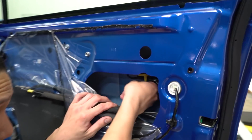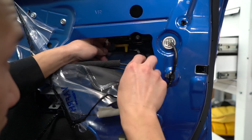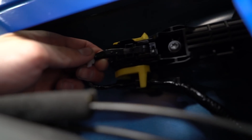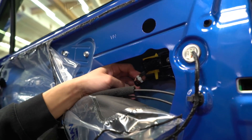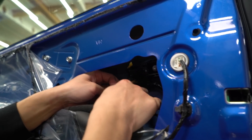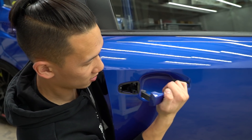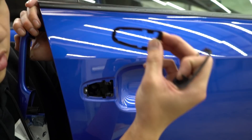On the inside there's a yellow tab and a harness. Grab your pick tool and go for the harness first — this is for keyless entry so the door unlocks when the key is nearby. Disconnect that harness plug. Next, pull this yellow lever down and out — this is what locks in the door handle. Now go to the other side and pull out the door handle: pull forward and out. Don't forget to take off the plastic trims — these stop water from going inside the door through the handle.